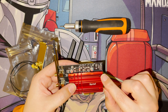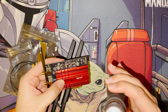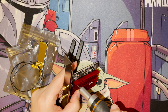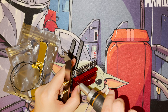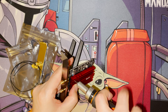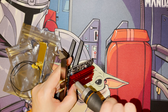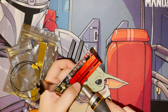First I'm going to remove the four screws on the heatsink. I've already got one out. They're not using a normal Phillips screwdriver — it's actually a small hexagonal head. Fortunately I have the right tool. The heatsink normally has some kind of thermal paste or thermal compound between it and the chip to transfer heat, so I might need to be a bit forceful to get it off.